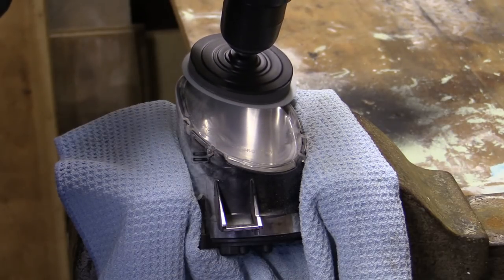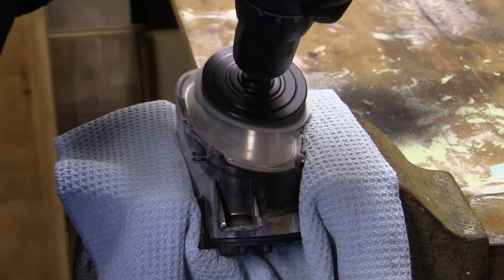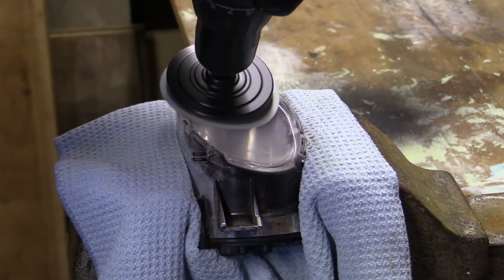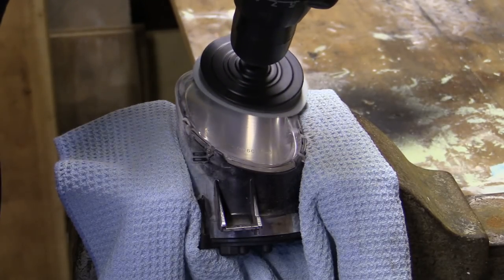This system is designed to progressively remove surface oxidation, not necessarily stone chipping, so while holding the disc flat to the surface would normally be the way to go, I had to edge the pad slightly here to ensure I got enough cut to abrade away those deeper imperfections.